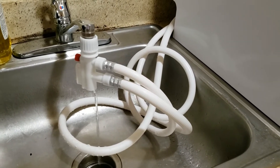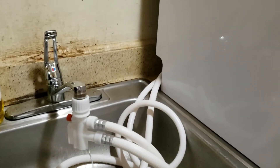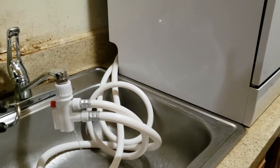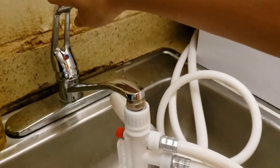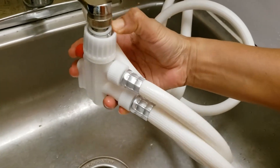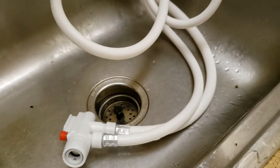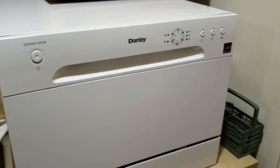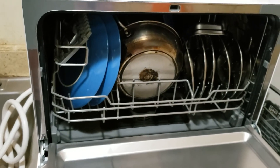The dishwasher runs quietly, but there is a water release sound which I found to be quite loud. Once the dishwasher finishes all cycles, we have to remove the faucet adapter. I keep the tap on neutral rather than hot water because this unit has an internal heating element, so I don't need to send hot water inside. Press the red button to release water pressure, then remove the faucet adapter by pulling it down. Be careful as some hot water may remain in the pipe.